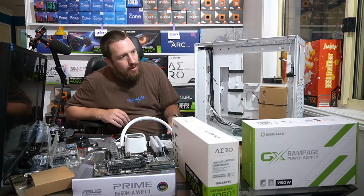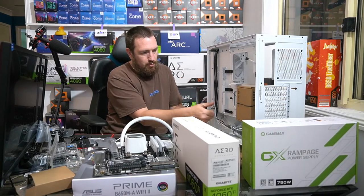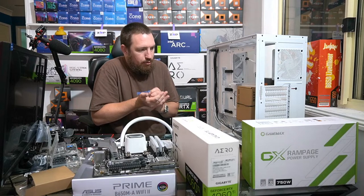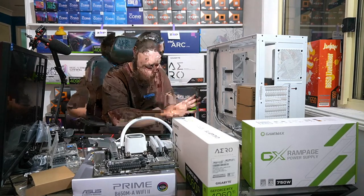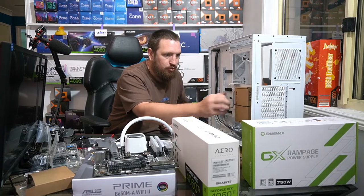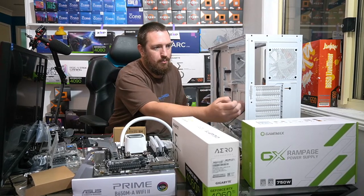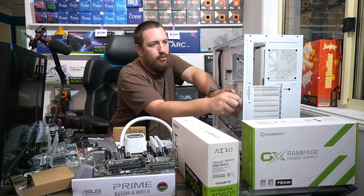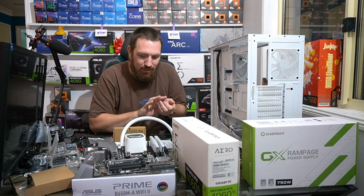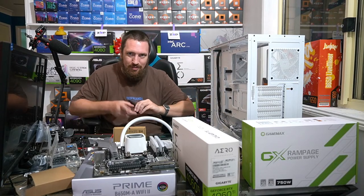Okay, so around the back here, these little wire ties and stuff like that. If something really needs to be tied, we can use a plastic zip tie. But in general, you don't want to tie down the cables too crazy back here, because as soon as you have a problem, you've got to cut it all out, and it's really annoying. If you spend a lot of time manicuring the cables out the back of your PC, I guarantee, for like 99% of people, as soon as you have a part that fails and you have to cut out those 20 cable ties, you won't want to put them all back together. Especially if you end up cutting a cable when you're trying to cut out the 20 cable ties, that'll really show you.